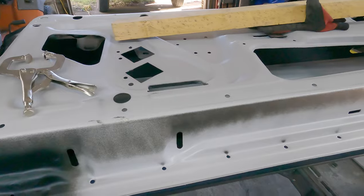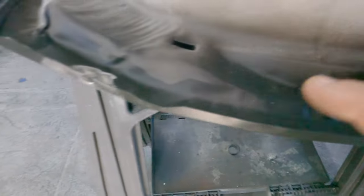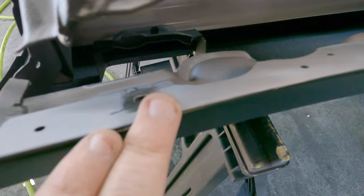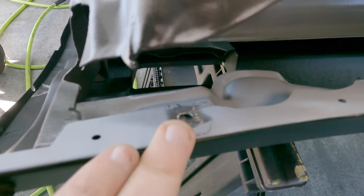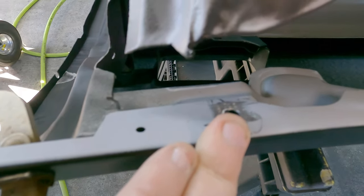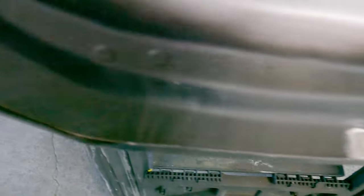Reviewing our prep here — I could weld through the primer on those if I wanted to, and I probably will, because once I get that folded in there it'll be exposed and start rusting out. So I'm going to use weld-through primer on that. Every spot does match up and it's ready. Up here, because I had done this so long ago — weld-through primer when it sits for too long is actually not very weldable. When you attempt to create an arc it doesn't really connect with the metal beneath it. So it's better to grind if your weld-through primer has been sitting more than about three days or so. Everything is prepped and ready over here, and on this side as well — I'm going to tack each raw metal section with weld-through primer.